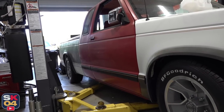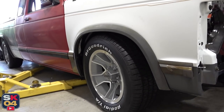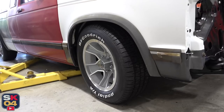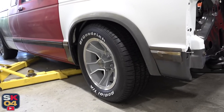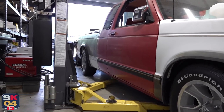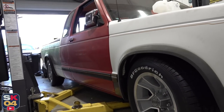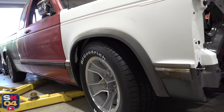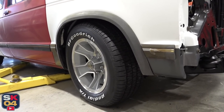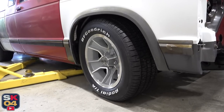It's all coming together — this is incredibly exciting. The tires I ended up using are BF Goodrich Radial TAs 225-60R15. Compared to the factory tires, these have a shorter sidewall and a wider contact patch. I didn't want to do an asymmetric tire setup. Obviously you can fit wider wheels and tires on the backs of these trucks, but up front is a little bit more limited when you start lowering. The biggest clearance issue would be the inner fender wells, and this fits pretty much perfect. I love a chunky tire setup, so this fit the bill without having too much poke — and of course the white letters were a must.